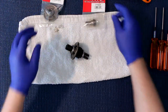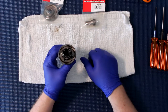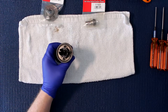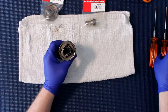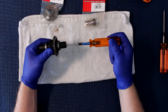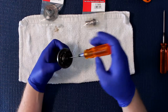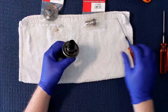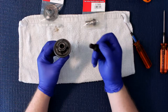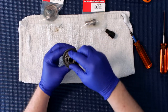What we're going to do is we're not going to touch this side here. We're going to open this side and confirm if the oil is okay at the same time. In the middle of your ring gear — your diff cup — you'll have a screw in the middle. You're going to unscrew that, and basically what that does is you can remove the cup. Make sure you don't lose your screw — put that aside — and you're going to be able to remove your bearing.